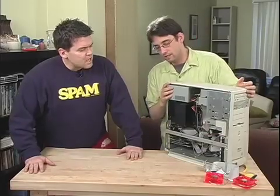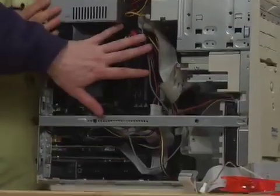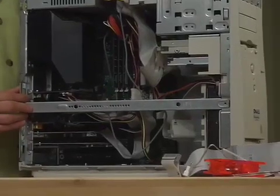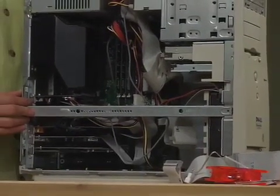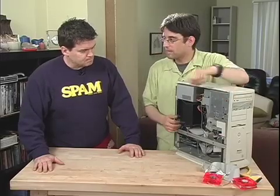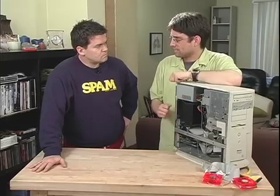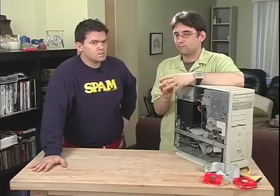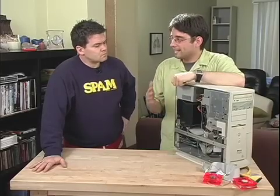Now what do we do about all these cables? Because there are zillions of cables all over the place — the power cable, IDE cables. Is there a way to actually clean these up? There is actually a way to fix up this mess. We had one viewer write in and ask about how the pros tuck cables in to make it look really cool — and that's not the only reason to do it. You often see that in performance machines, because it takes cables out of the way of other components and allows airflow.